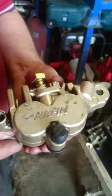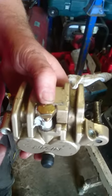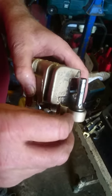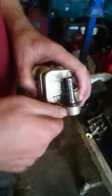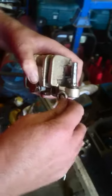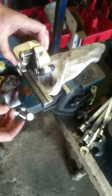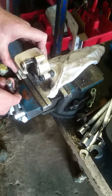What we've done is we've blocked off the brake pipe hole and we're going to put a grease nipple into the bleeder hole. These pistons just wouldn't move. Into the vise then — we're just going to keep one piston held.